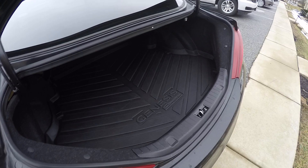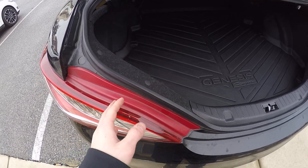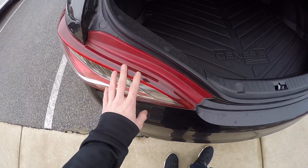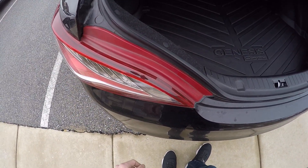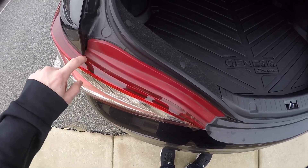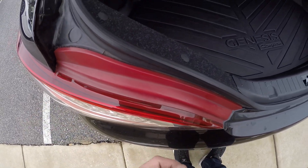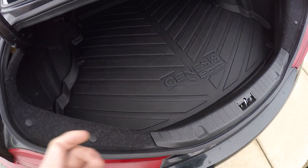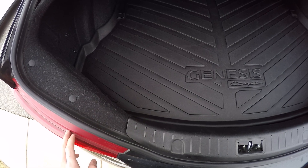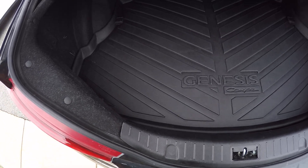That's gonna be it for this one guys. If you end up replacing these, or Hyundai replaces them, or if you ever need to take it off or put a new one on, this is a quick video on how to do that. Also, if you do have the condensation leak, you could pop the tail lights open and reseal the whole tail light around the top and sides with a flex seal or some kind of clear silicone — that would basically seal it back up.